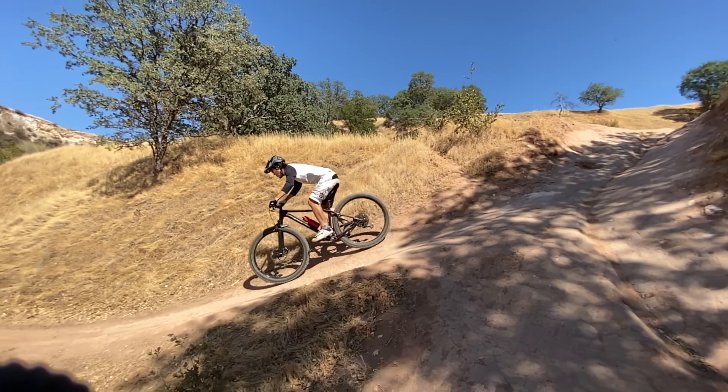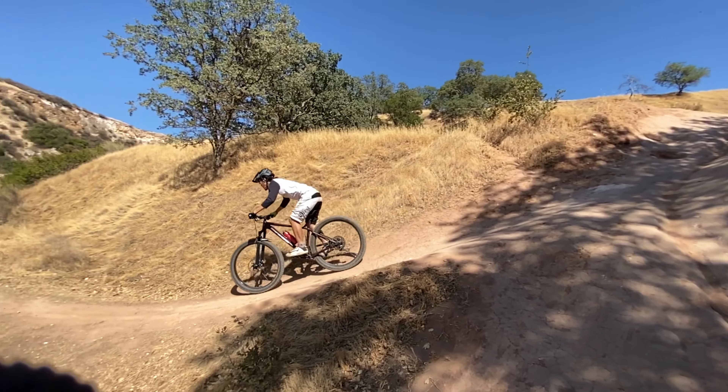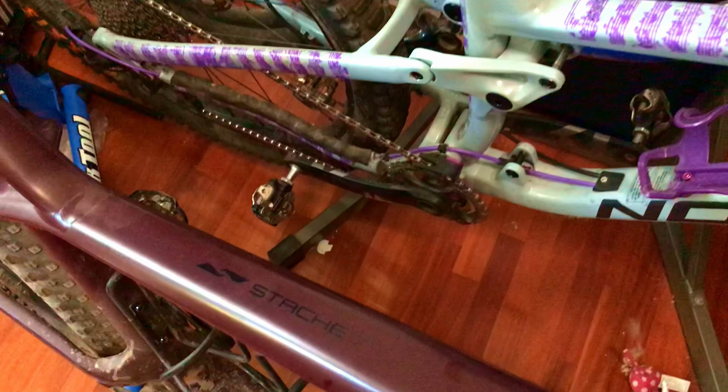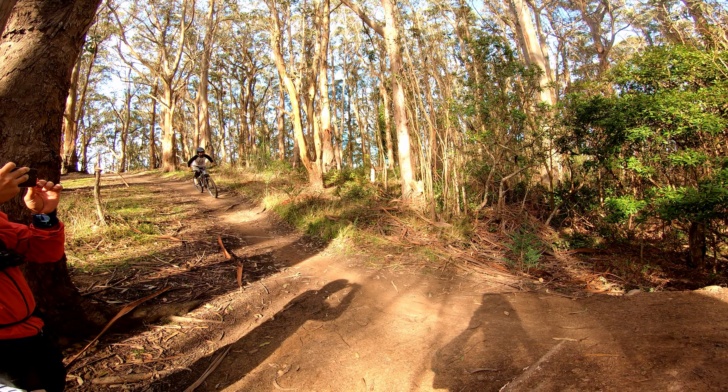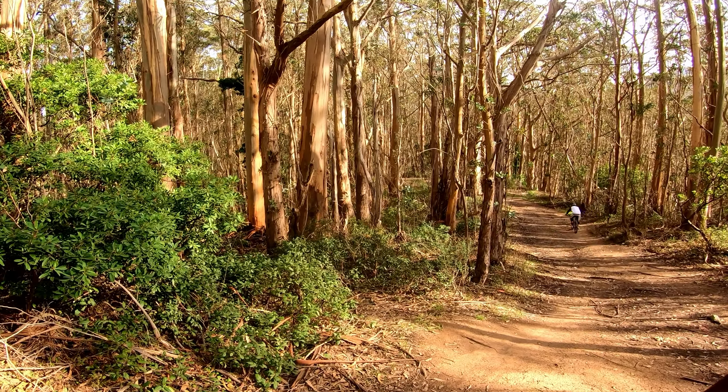Here's how I had this bike set up: it's got a RockShox Yari up front with the simple motion control damper, which actually isn't too bad. I ran it at 85 PSI with three clicks of low-speed compression, and that was pretty much in the ballpark. For tires, there was a Bontrager XR4 on the front and an XR2 in the back, both 29 by 3.0, running 16 PSI in the front and 18 PSI in the back. I know a lot of plus bike riders are thinking that's crazy high, but supporting the tire felt more important than raw traction, and 16-18 PSI was the lowest I was willing to go — and even then it felt a little squirmy.